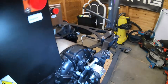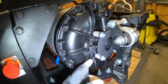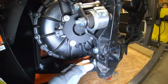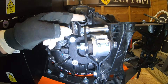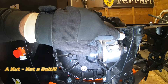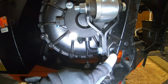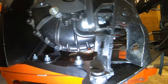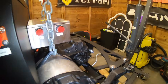The side mount is a very clever piece of kit. You've got a bush that mounts to four bolt holes, spaced out, and then a metal bracket designed to fit into the original Boxster piece. There's a bolt going through with a nice spacer, and a bolt at the bottom with a nyloc nut. You can't get a spanner in there, but you don't need to — just wedge a screwdriver in to stop it turning and tighten from the other side.